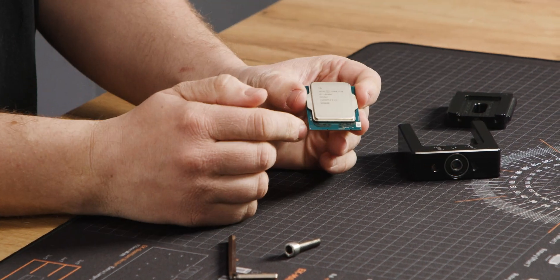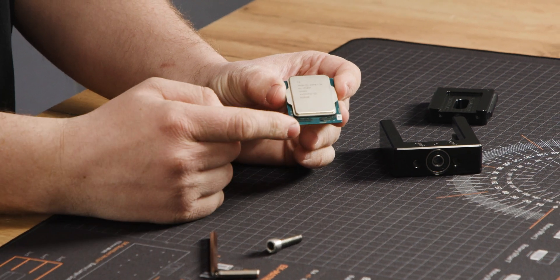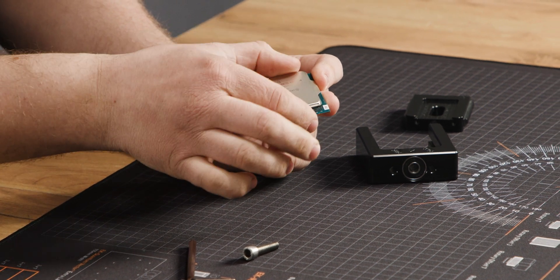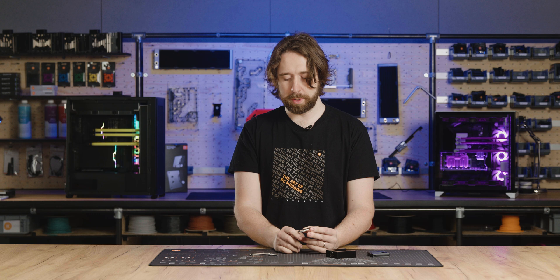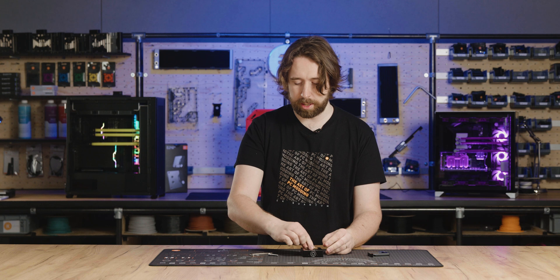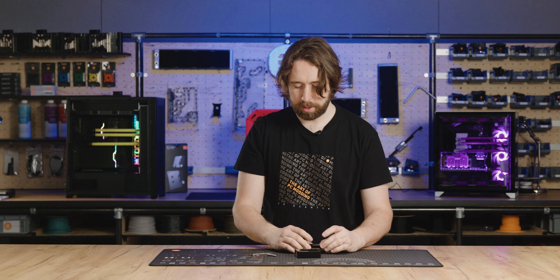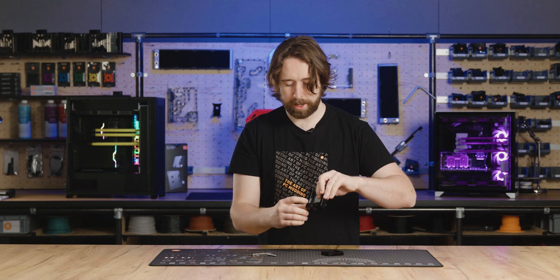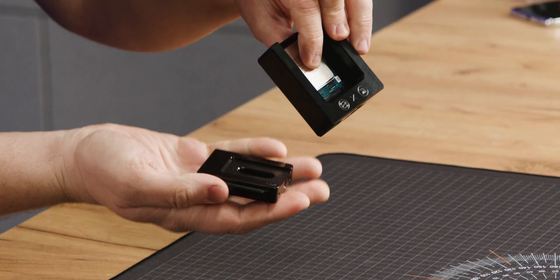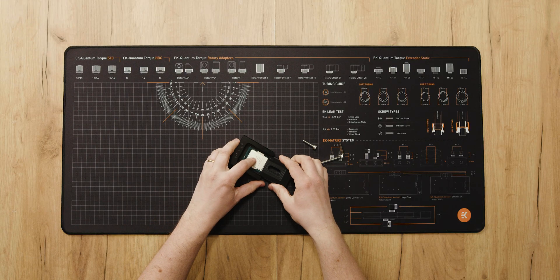You can see it's quite nicely moved away — you can see the glue on the bottom side and everything looks good. Now we're going to push it back to the middle and repeat that process a few times to make sure the indium lets go. It should be a little easier even though it's cooled down, since it's been sheared once. The triangle is now in the position two corner, so we'll use the slider with triangle two facing up going to the same corner.